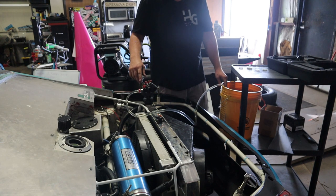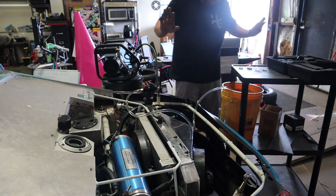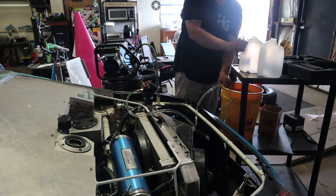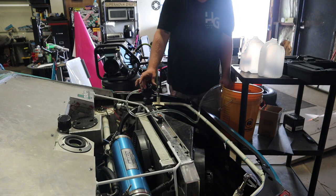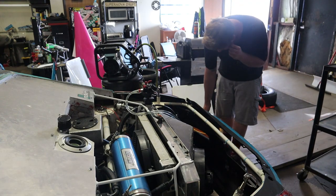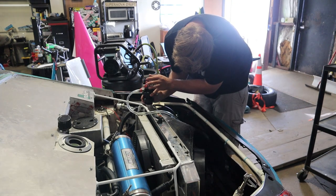I'm actually running out of water, so I'm going to shut that valve and figure out a way so this isn't going to fall. I started with three gallons — this is another two, so there's no way this system is five gallons. We're at zero, so you shut the line. Now you're good. This can come out of the water — just let that hang. Pull your hose off, and you can unhook this piece, loosen it up, pull it off. Now it's vacuum bled.